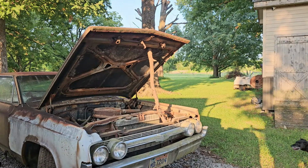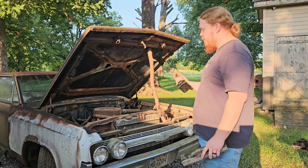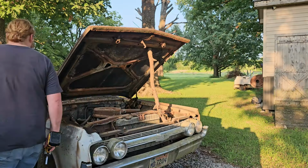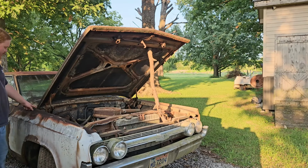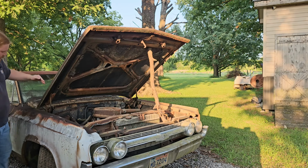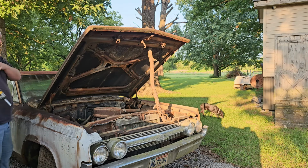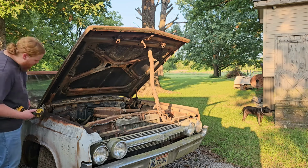All right, let's get to it. I'm by myself, obviously. I got a 2x4 and an impact wrench, so let's see if we can break something or maybe have a successful go at removing this hood and getting it out of the way. My goal, I'm gonna wedge the wood in here, loosen these bolts. I've got my third point of contact there, so I'm hoping that with the wood and this loose, this will still remain. Then I can walk around, unbolt the other side, and then pull the wood out, and with my third arm that is invisible, I'm gonna somehow maneuver this onto the roof of the car. So let's see what happens.